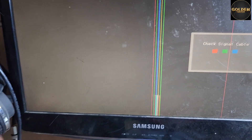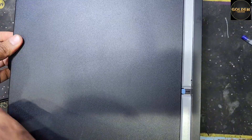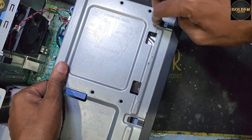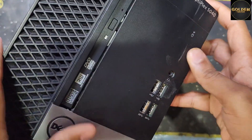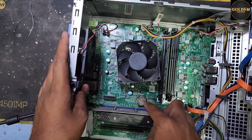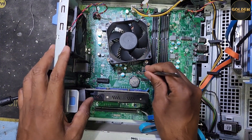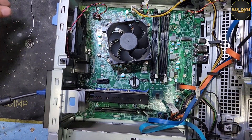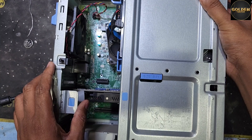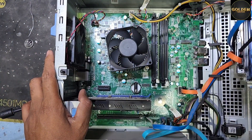You can see here there is no display picture. Now I will open the case and remove the power key cover, remove the phone case, and remove this battery. After removing the battery, remove the power cable and then press the power key for 10 to 20 seconds — keep pressing, don't release the power key.